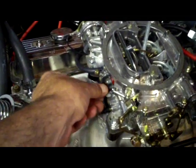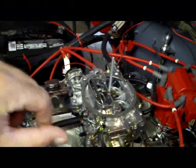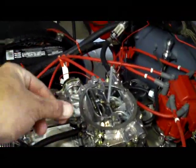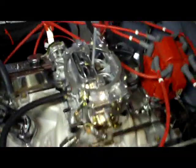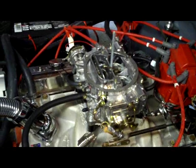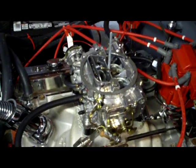And then when I went up here to adjust the carburetor, these are the air fuel mixture screws, and what you do is turn these inward to the right until the engine starts to run a little bit rough, because that way you know that you're shutting off a lot of your air. And then you turn it out about 1 whole turn, and then do the same thing on the next screw. And then obviously you're going to have to adjust your idle setting, and I would recommend about 750 RPM at idle. Then also we went ahead and put our inline PCV valve here, going to our breather, so that took care of a vacuum leak.